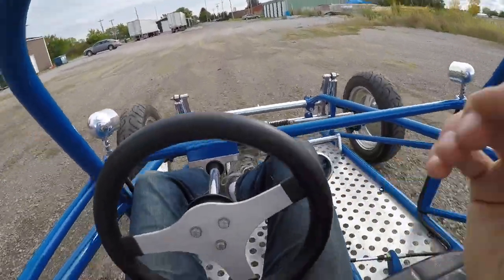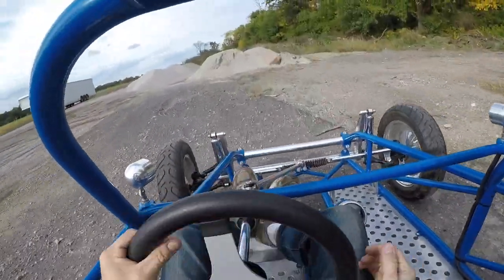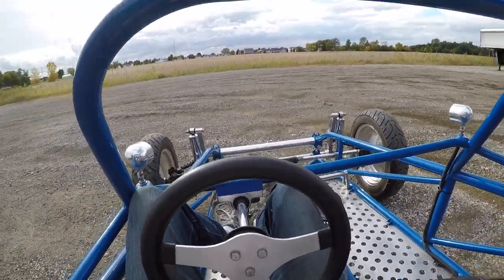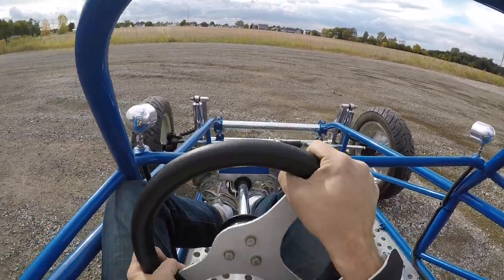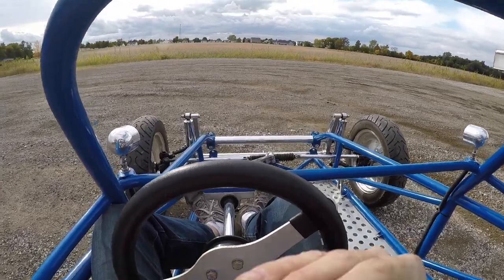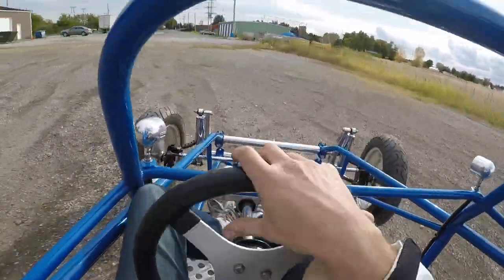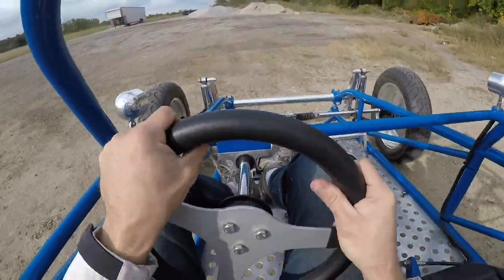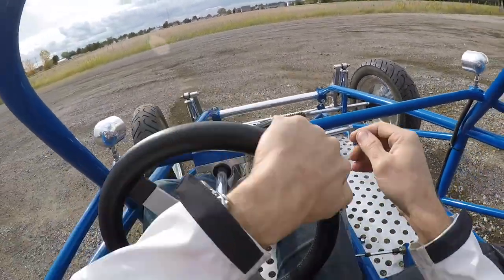On some closed-circuit area on asphalt, you want to get some forward motion started to work with. You want to get your tires spinning so they have the opportunity to slide sideways. The reason you want to go straight initially is so that when you have forward momentum, you can huck the front end into it — and that'll get the rear end, once the tires are already spinning, to come out and take a set. That's how you do a really good power slide in a tight area.